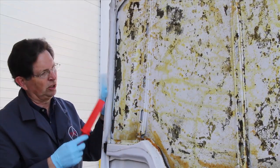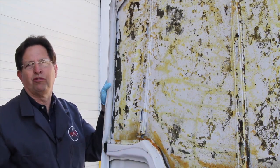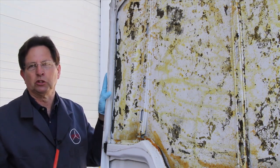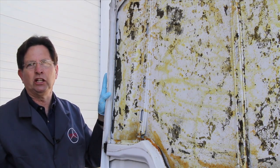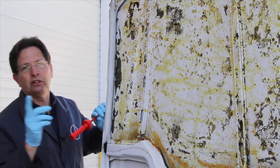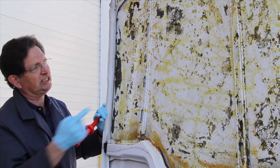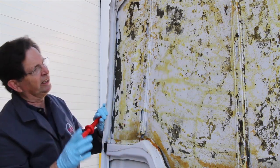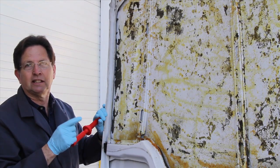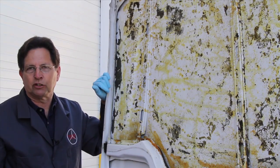When you're scraping off this glue, it's not necessary to get every little smudge of old foam off the hood, because the hood pad has a lot of texture to it and it will not show when you glue the new pad to the underside of the hood. But you do need to get it clean of any large pieces like this here. If you look closely you can see these spray patterns — this hood's been replaced at some point. That's not factory glue, and it looks like they just sprayed a spattering of glue all over the hood inconsistently. That's probably one of the reasons why the hood glue let loose and the pad was sagging in the first place.